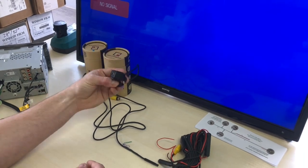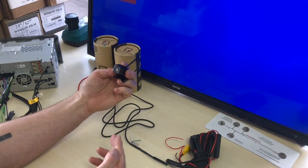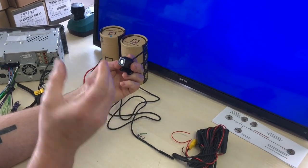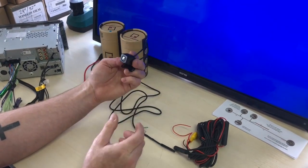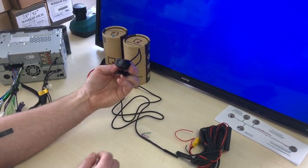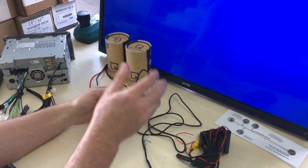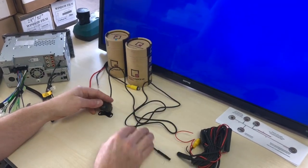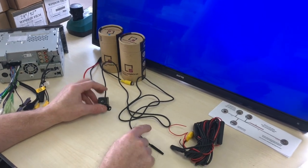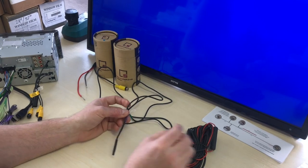And the same if you want to mount this on the front of the vehicle rather than the rear of the vehicle, you can actually cut the purple loop and it will flip it horizontally, so the perspective of what you're looking at will be correct to the vehicle, whether you use this on the front or the back of the vehicle. So you don't have to mess around changing the brackets and things to get the image projected the right way. That is one of the most important things about these loops. We'll demonstrate it on this screen later just quickly.